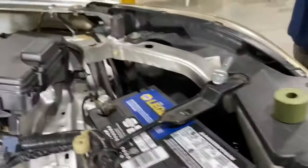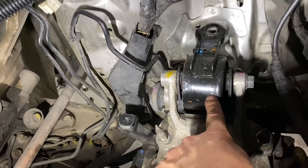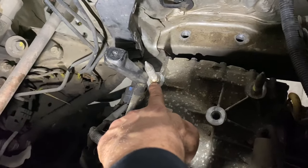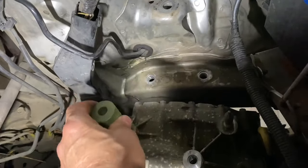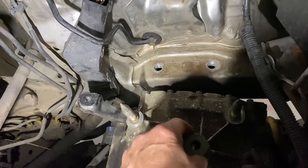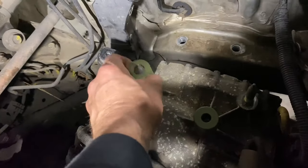Once all those bolts are out, you can just lift this entire assembly up and then you should be able to drop the spacers in place. Make sure there's a way to put these on — notice this stud has a wider base to it. If you put the smaller spacer on there, it doesn't go down all the way; there's a gap of about an eighth of an inch and you can't get them tight. So the one with the smaller hole goes right there, and the two with a slightly larger hole go all the way down over top of that base. That's how they're made to fit.